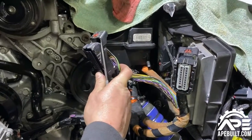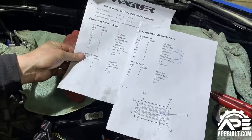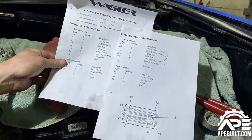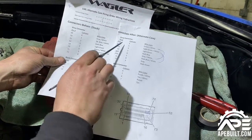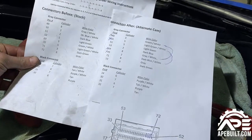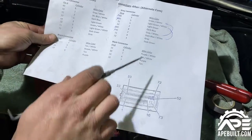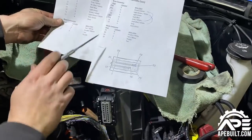We put an alternating firing camshaft in here. With the alternating camshaft wiring instructions, you have to go in and look at your gray connector and black connector, decipher which pins you need to pull and switch to the appropriate wires. We've already done the gray connectors and we're moving on to the black connector.